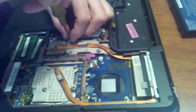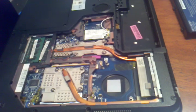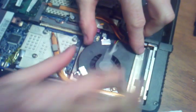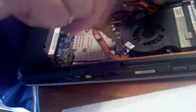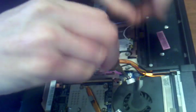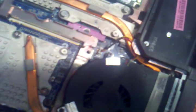I'll see if it will install the card itself. Then the fan's going to go back in. Remember you have the two little screws — there are only two screws, not three, even though there's a spot for three. Now here's the most important thing: remember to put the connector back in. It just slides in a little bit. These little wires go underneath that tab, between the two.